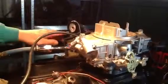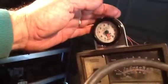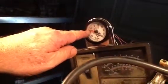We've already set the mixtures, which are here and here. We've got a vacuum over here, so if you need to hook up your distributor, windshield wipers, radio, whatever — hook it up to it. When this red light goes out, that means the computer has computed and calculated exhaust, sitting on 11 and a half parts of air to one part of gas. That's a very good mixture; somewhere between 11 and a half and 12 and a half is a good place. As you accelerate, you notice it thins out — because you don't need as much liquid gas to propel you down the road.